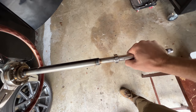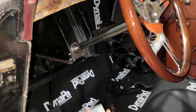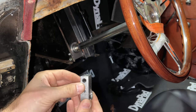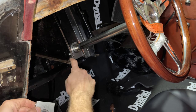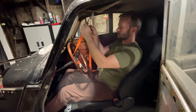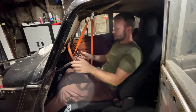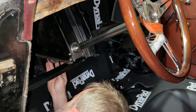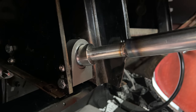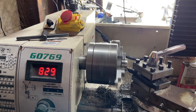Behind that we have a 1 inch steering shaft that goes down about a foot, then changes to a 3/4 inch stainless shaft. The steering shaft is held in with mounted spherical bearings. I bolted in the first one in the same location as the stock steering shaft bearing so that my column will exit the dash in the same place. I drilled through the sides and added a tapped hole to keep them from rotating. To get the right column location, I set the seat in the car and hung the steering wheel in a location that felt right, then bolted in the rear bearing based on that shaft angle. To keep the shaft from moving in and out, I added collars on each side of the spherical bearings. The angle of the shaft made them rub on the bearing housing, so I put them in the lathe and chamfered the edges.